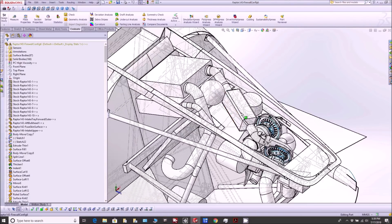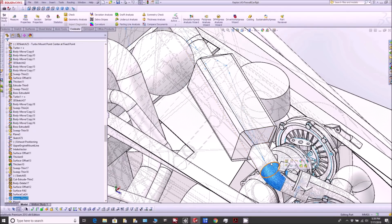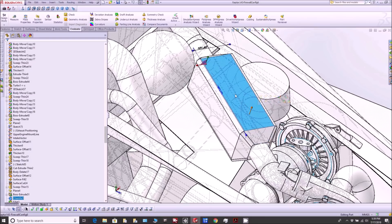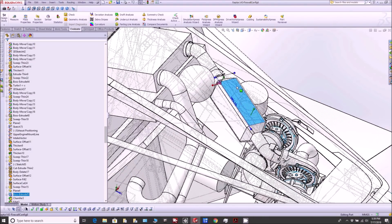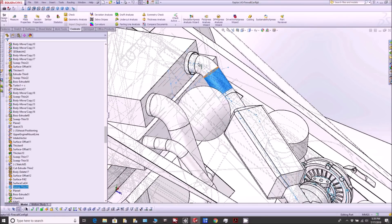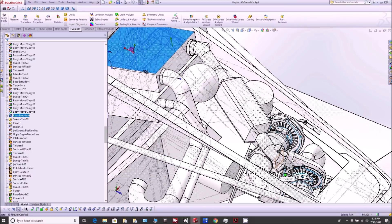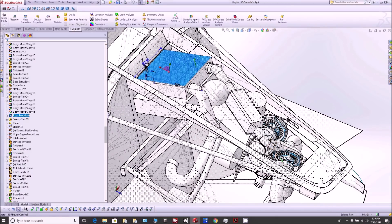Here's how it'll look where I'm going to position it. It'll be coming right out of turbo number two, go through this one and basically take as much heat out of that hot air as possible, sending that into the wing tanks. Then it'll go through the second intercooler where it'll get air cooled. That'll actually help keep the engine cool as well because there won't be as much hot air coming out of the intercooler going through the radiator. So it should be a win-win-win.